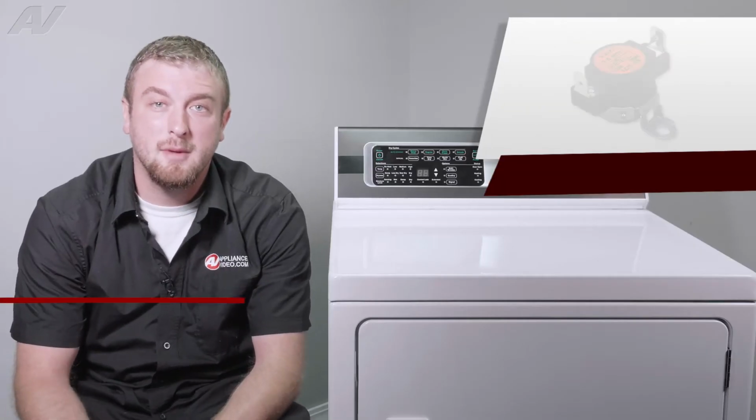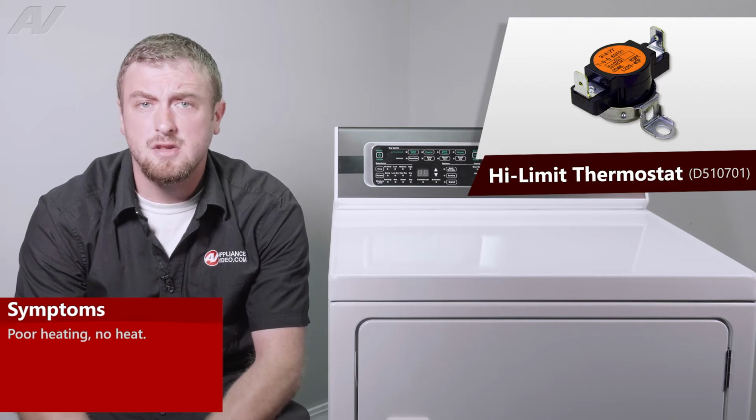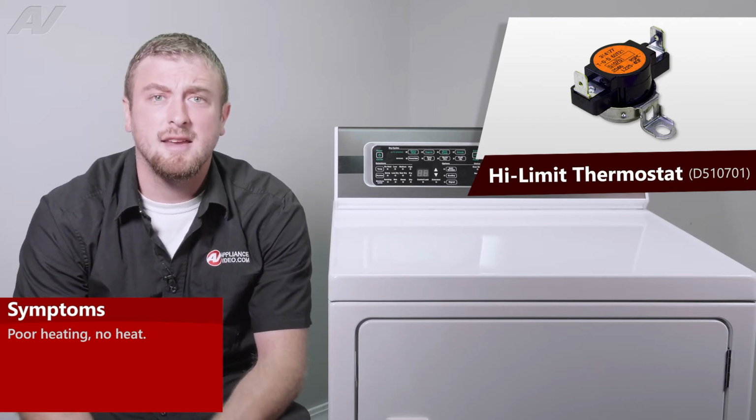A bad high-limit thermostat and fuse would often result in poor heating, or the fuse could be bad, causing it to not heat at all.